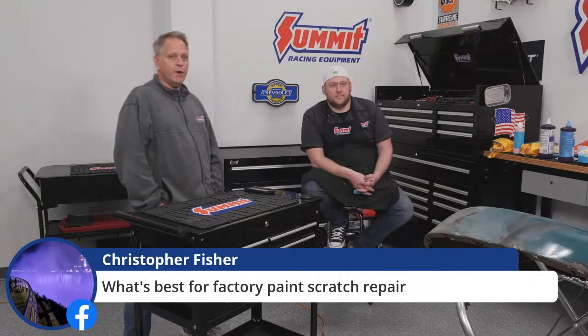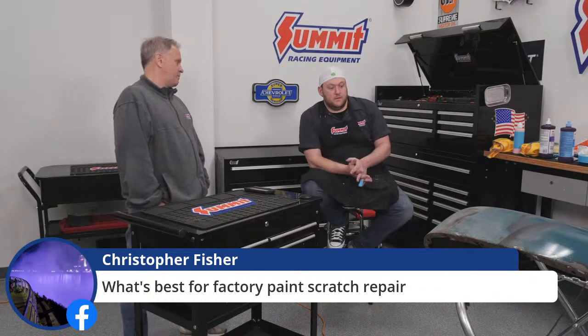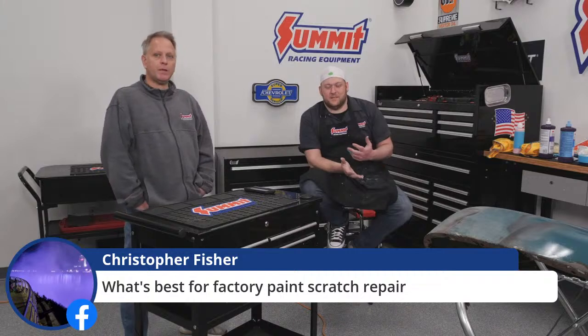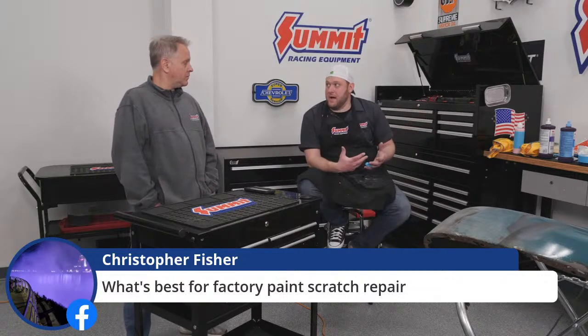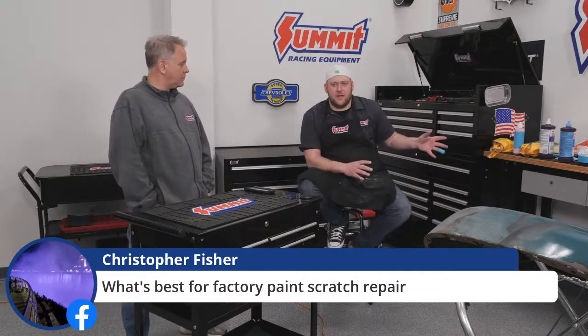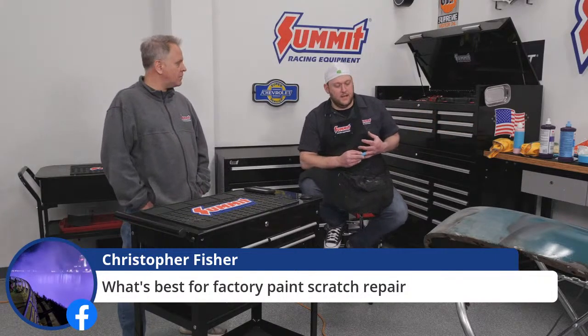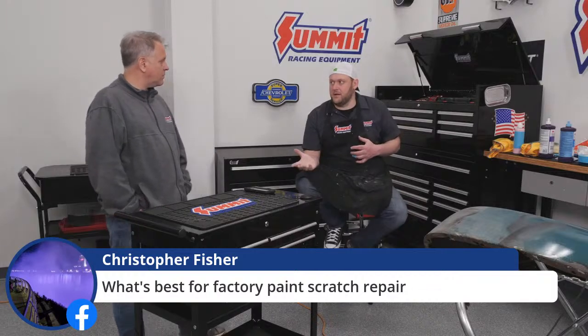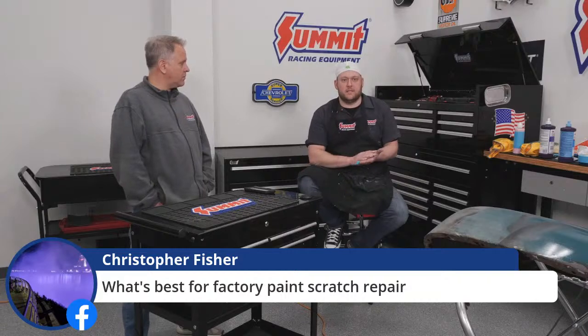Question from Christopher. He's getting in here on the tail end about factory paint scratch repair. Any recommendations? Best thing for scratch repair, as long as it's in the paint still, if you can still see color in it, you can use like number 1 or a compound. And you don't have to use 3M number 1. That's my preference. That stuff's fairly expensive, but it's just my preference because I know how it works. There's a bunch of other ones. I know Chemical Guys makes one that's pretty good.